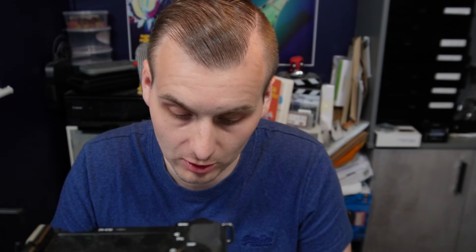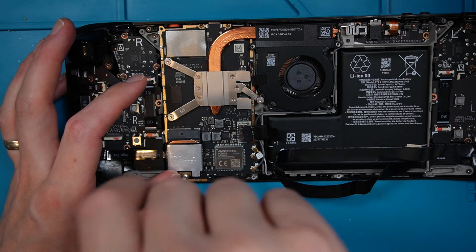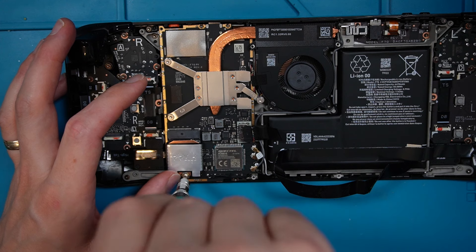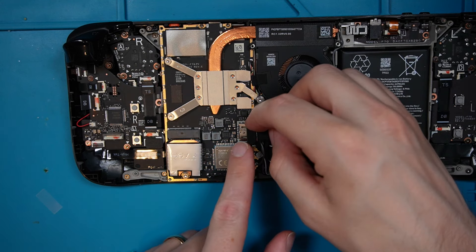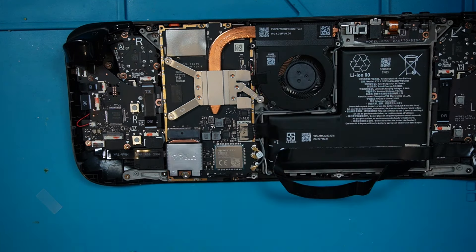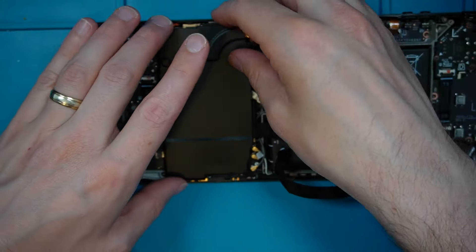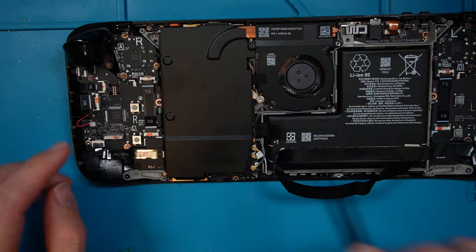We can reintroduce the screws. I will put a link in the description to show you how to clone this — I pre-cloned this drive prior to doing this as I don't want to have to reinstall everything. You can do a fresh boot instead, and if you ever want to see how that's done let me know and I'll get a video out. SSD is in there. Now I'm going to line the battery back up so we can push it back down once the heatsink is good to go.